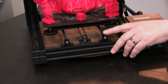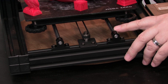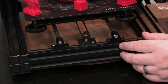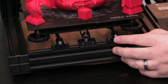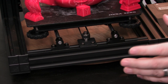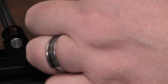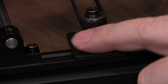At the rail section on the bed, you'll notice they've gone with cylindrical rods, which was very common on older 3D printers — even Prusa used these for a number of years. People have started to move to the extrusion and wheel combination, so I think this was kind of a step backwards. Although it does work — the rails are straight, it slides nice, no bottoming out. The center tensioning wheel on the Y-axis lets you loosen two screws and move it in or out as needed, so you can tension the belt over time.